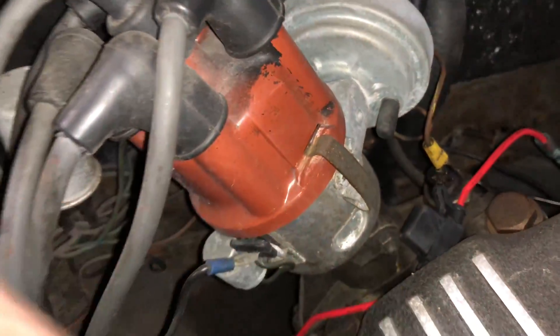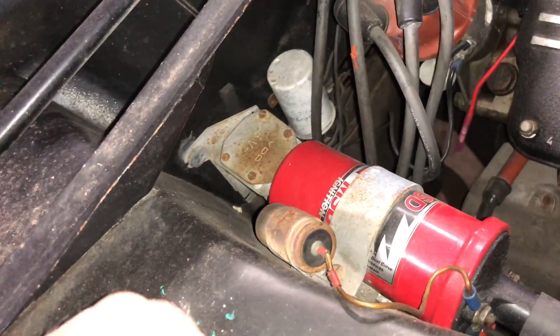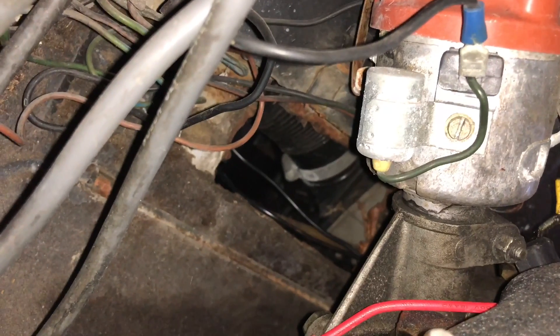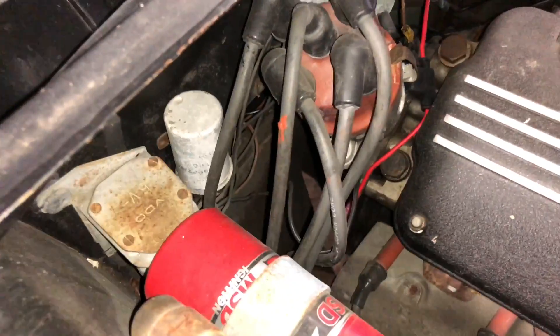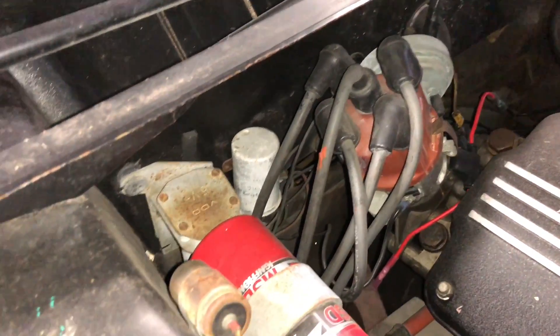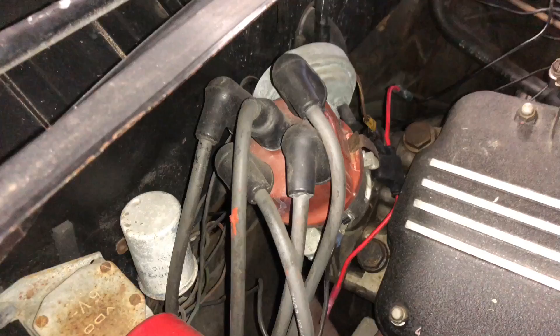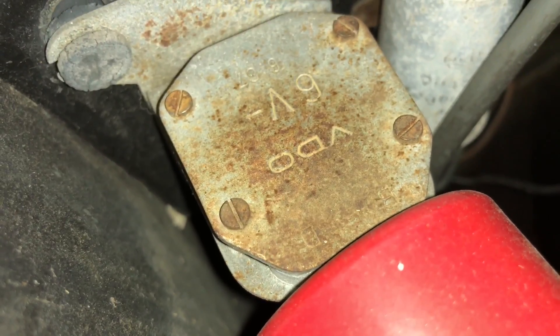Now it's time to loosen up the distributor, take the cap off, take the plug wires out, and the coil off — I'm not going to need any of that or its supporting hardware. Then I can get a better look at what's behind there because I'll have to go through the firewall. There looks like there's ample room for the MegaSquirt and the EDIS controller box. I'm going to slot my O2 Again dizzy block-off plate in there — should be pretty rad. I just noticed this says six volt.